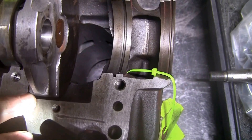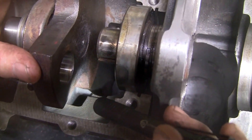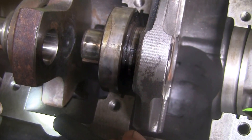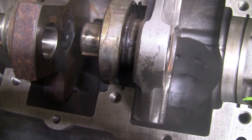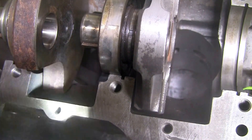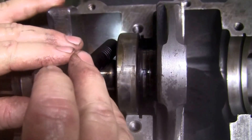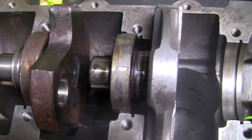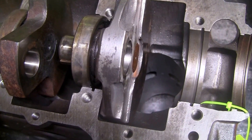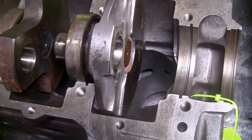Those results are backed up by the dyno test. Here's a T weight in there — you can see how it's wide open. Even with the weight all the way across, it's a smaller diameter, because in the old days we would stuff and make everything bigger in the bottom end. Stuffing's out today; today we go with more air in the top. This allows more air to get through in the rear, and you've got pretty good flow up front. The result is a pretty decent horsepower gain. There is a trade-off — you're going to gain it in the drivable area up to around 4,000 RPM, where you can really expect to see great gains that are not going to be offset.